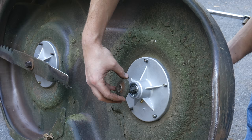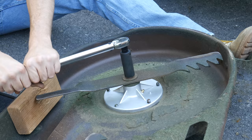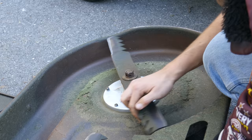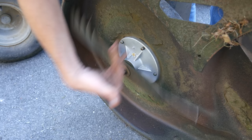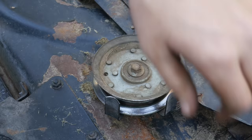Once we've touched up the blade we'll reinstall the shaft and the spline spacer, then on goes the blade, the washers, a few drops of oil, and the blade nut. Again we'll jam up the blade and torque the nut down to 70 foot-pounds. The oil on the threads means the fastener is a little bit tighter than the spec, but the rust probably also increases friction so they're probably counteracting each other. Again we'll make sure the blade is centered and spins easily - it's a little bit harder to manually disengage the brake on this side but everything should be just fine.